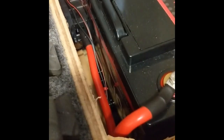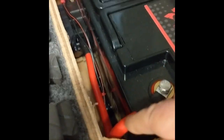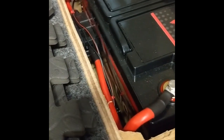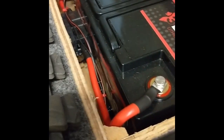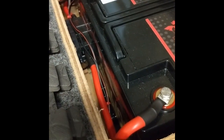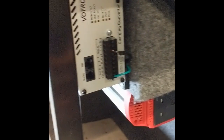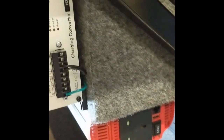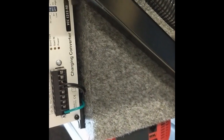Here's the new cable we installed at 16mm. The original cable was about 10mm. This is going to carry 50% more current and also reduce voltage drop, which is always a good thing. And we have the battery-to-battery charger — it just fits in here. It's not terribly big, but that is a 50 amp battery-to-battery charger.